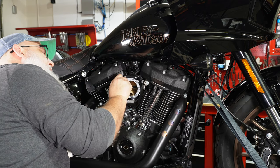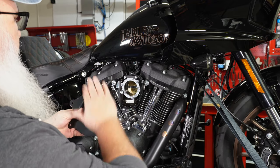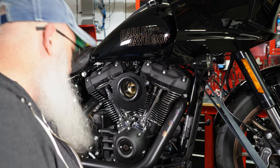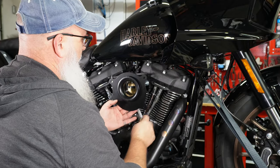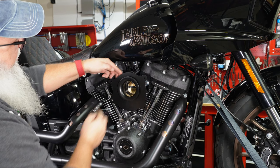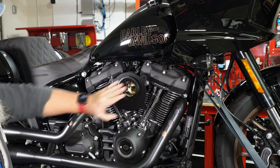Make sure you have your breather tubes inserted the way they go before you put the cover on, because trying to get them on afterwards is a pain. Then just turn the cover into place like that. Once it's on, start tightening up the bolts. Once that's all on there nice and secure, connect your breather tubes and make sure they're pushed down all the way. Check the holes to make sure there's no kink in the tube and that it's seated well — that way there's no chance it'll fly out. At that point we're ready to put the front piece on.